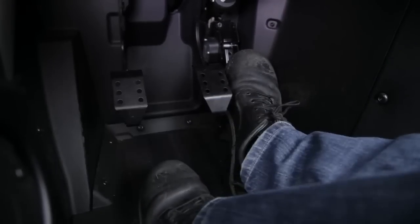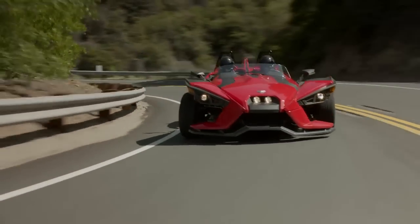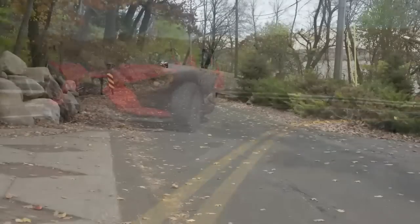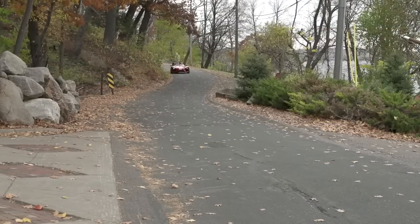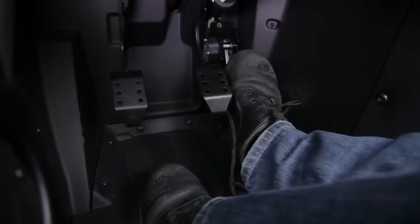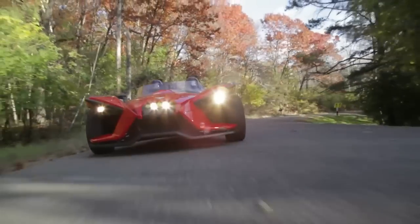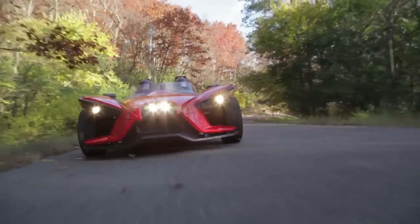Release the clutch pedal very gradually in these conditions. Avoid downshifting in a curve. Downshift before entering the curve. Avoid coasting with the clutch disengaged through curves and corners. Accelerate by depressing the throttle pedal. For even acceleration, depress the throttle pedal smoothly.